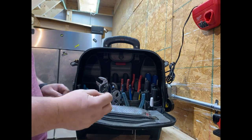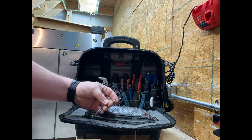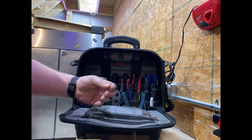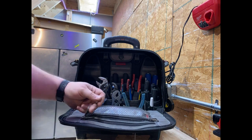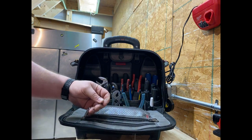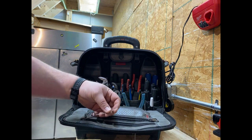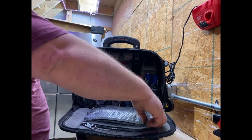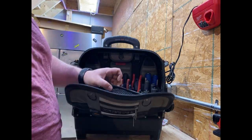You may ask why I have this little wire here. This little wire is the perfect size for cleaning orifices out on a water injection for a Convotherm combi oven. If I don't have this, I always try to find a sprinkler wire, like from the tag, but I just learned to keep it here so I always have it. This zipper compartment, I keep my right angle adapter.